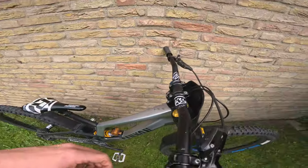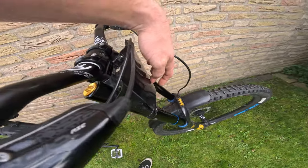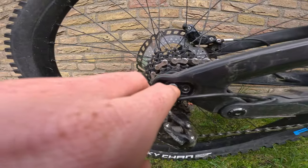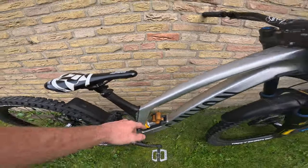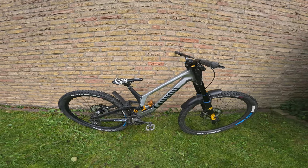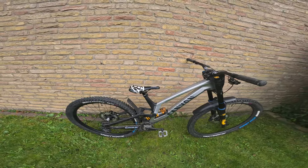I'm all the way in the back. Just make sure — with Rock Shox it's not possible because the crown of the fork hits the frame, so think about that before you change it. In the rear I'm in the short mode, which is about a five mil difference, and I'm all the way short. The frame size is a large — I'm 175 centimeters, so I've been running a large for the last three years. I rode the full 29er version too, but for most races I prefer the mullet — the 27.5 rear wheel — just to keep it a bit more playful.